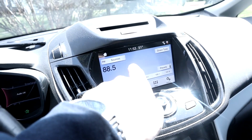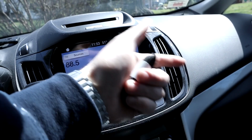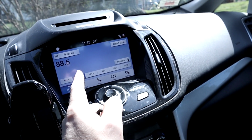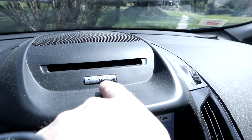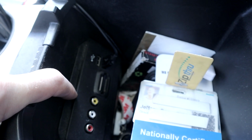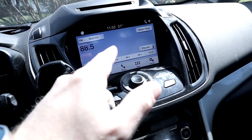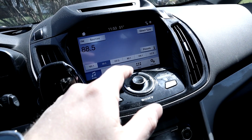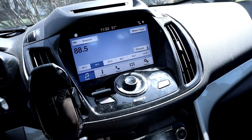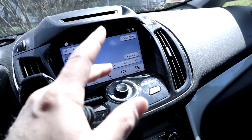My setup I have here, as you can see on this screen, this is a Ford C-Max, so it's kind of like a Ford Focus. This is a Sync 3 device. However, if you look everywhere, it says Sync powered by Microsoft. This is the old setup for a Sync 2 device, or MyFord Touch, I think they called it. But I've upgraded this myself. I purchased from a junkyard a new Sync 3 module. You can retrofit them in here into these Sync 2 vehicles, do some programming using ForScan to set it up to get it working with your car.